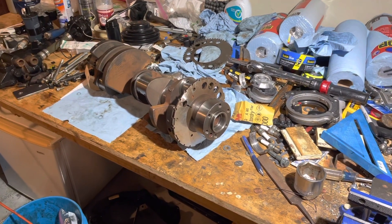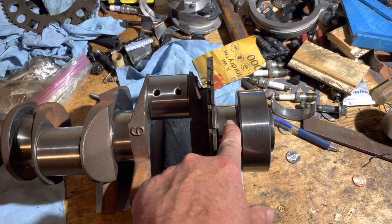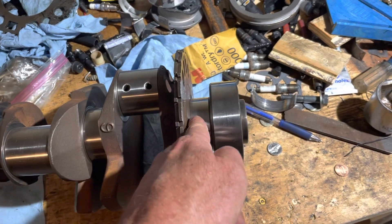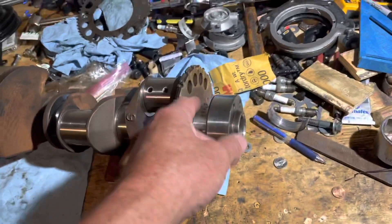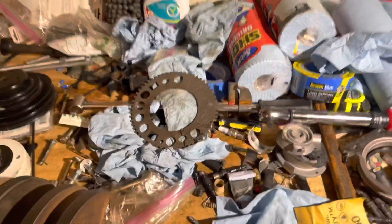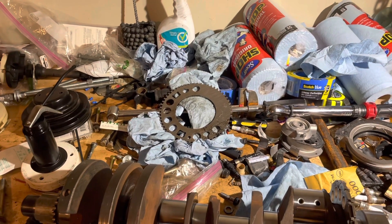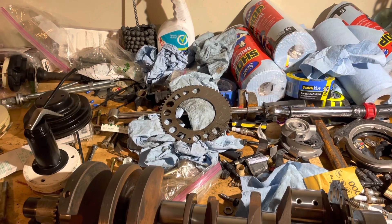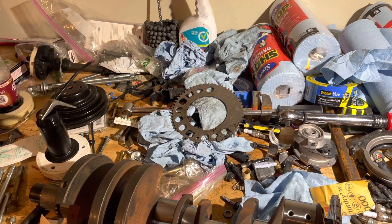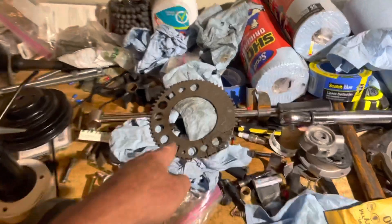So what we're going to do is take tape and protect these journals. We're going to wrap these journals pretty thick with tape so that when we knock this thing off, it won't hurt the journals. And then once we get this trigger wheel off, we're going to heat that trigger wheel up to approximately 500 degrees. I have a barbecue grill that I've re-plumbed the jet on so it takes all the heat into one specific spot — I actually use it for a rod heater.